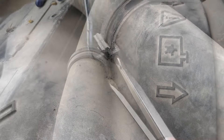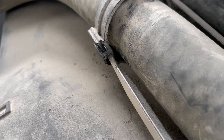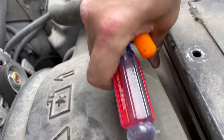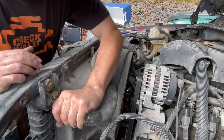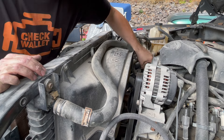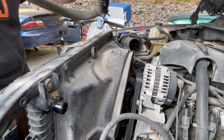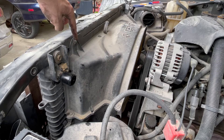I'm going to work this clamp out — I'll use my screwdriver and push on that tab, then use my pick tool and just lift up on it. To keep your radiator hose in place you want it to be good and tight. I had to work them a little bit because they were kind of stuck, but they're finally broken loose — so that's off the water pump and the radiator.